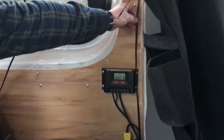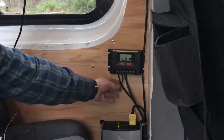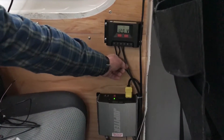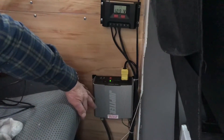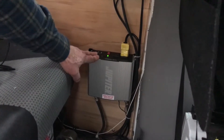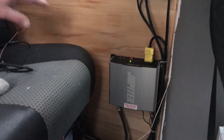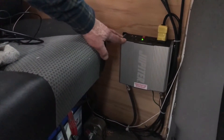Power comes down from the 200-watt solar panels into the bottom of our charge controller. Coming out of the charge controller, 12-gauge wires go to the batteries down below. From the batteries we have double-aught wire coming to the bottom of the inverter, and then one circuit from the inverter goes back to our kitchen pedestal where we break that current down for our LED lights and our 110-volt receptacles.